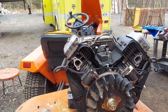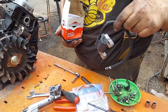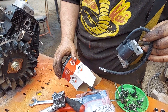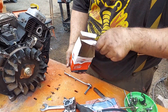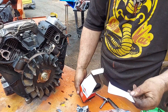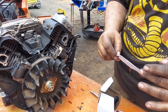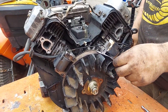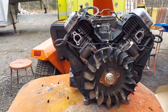So whoever gets this box with the fingerprints on it, I promise you it's brand new — I apologize. These are the brand new OEM Briggs coils. You got to put your spark plug end on depending on what style you have — it comes with the Briggs ones. They give you this nifty little tag with some instructions. The point of this tag is the thickness is actually what they tell you to use to gap this. I'm going to use feeler gauges — that's how we usually do them — but this is handy and works just as well. It's not super critical as long as they're not touching and not too far away.